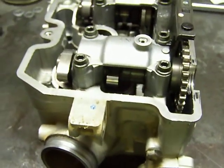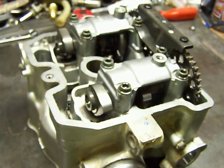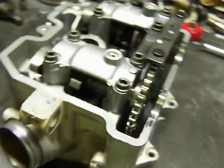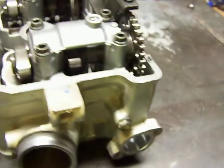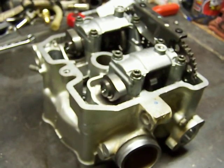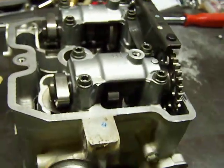With the intake valves, I want them lapped in. I guess I need a shim kit — $65 for a box of little round pieces of metal. Send me the valves first and we'll see where I'm at with the shims I have. I refuse to pay $65 for a box of shims I'm only going to use two of. Alright, found it: zero intake lash and bad rings.